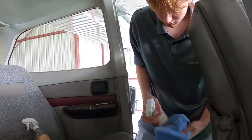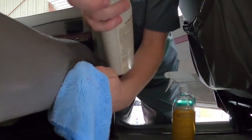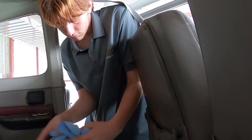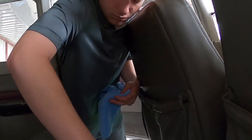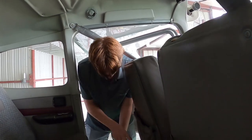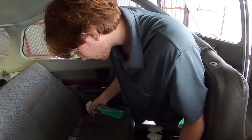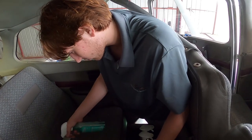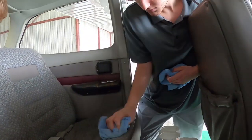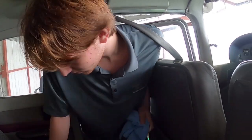Andrew is currently applying the leather care, which is used to protect and preserve the vinyl and also ensure that moisture stays within the vinyl so the leather and vinyl do not crack. He dries it to make sure no streaks are left and the product is secured within the area. Then he takes the interior cleaner and applies it to the main part of the seats — this is what we use on all cloth seats. He soaks it in and then rubs it rigorously to ensure the seats are cleaned and all odors are removed.